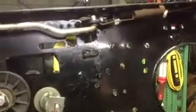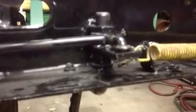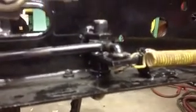And then I've done the same on the brake side, if you can see that right there. So just a little adjustable stop. And then I've got that helper spring right there to keep the pedal, when it's at rest, tied against the stop so it's not bouncing around. And then of course you've got your clutch spring right here. The other thing that I've done is I've put shims on both sides. I've got washers on both sides of my linkage here, so that keeps it moving freely.